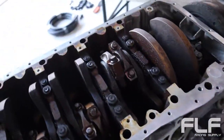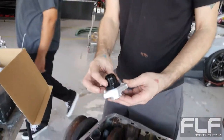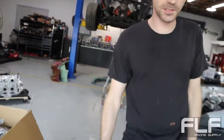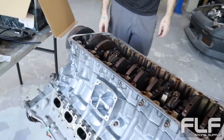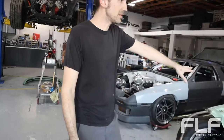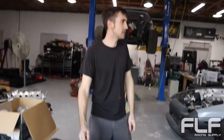Right now it's upside down - I designed the oil pan. They don't make parts for these motors, so like this is an oil fitting for the water block that we machine. We're basically designing everything on it. Full dry sump, build the oil pan. Naturally aspirated - we got an ITB setup that we made for it. Trying to get like 600-700 horsepower NA out of it. We're going to compete with this car too - do global time attack and that kind of stuff. HGT sequential behind this as well.